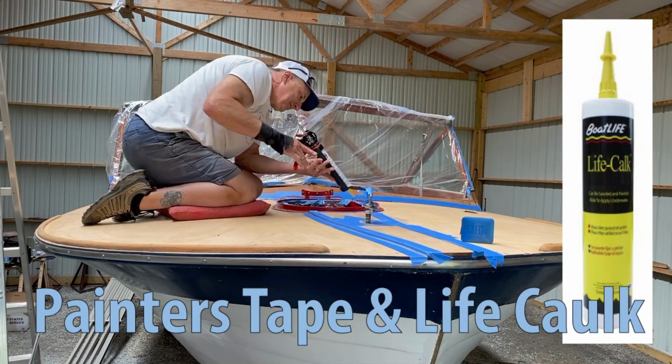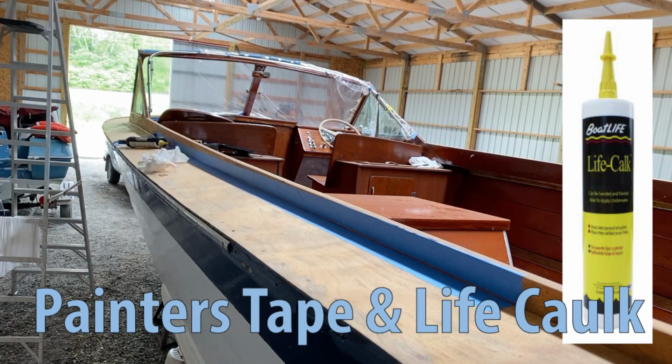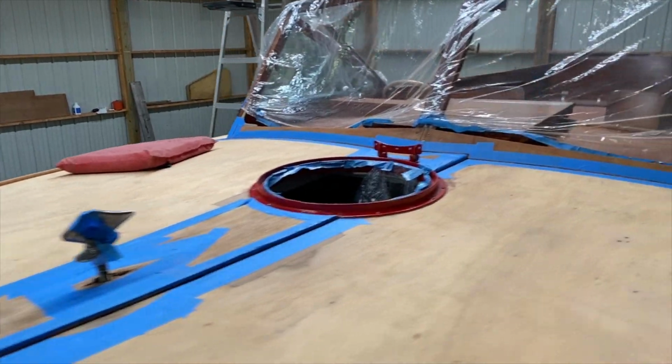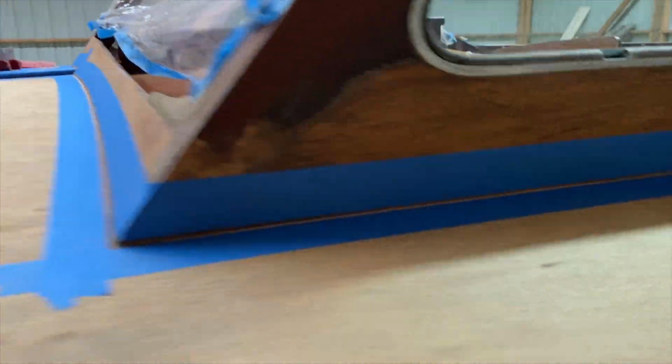I can't remember who commented last year saying to tape off when caulking. Brilliant. The tape was pulled away carefully right after the life caulk was pushed into the joint and smoothed with a finger. The life caulk needs to be pushed into the joint. It adheres better that way.